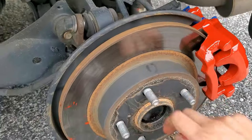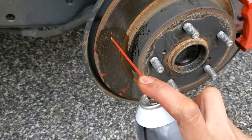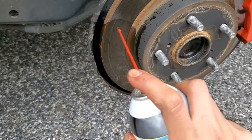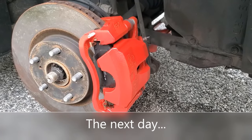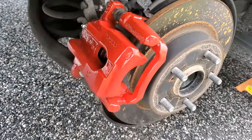Time to do some minor cleanup. Go ahead and rotate the rotors and take whatever brake cleaner you have left and spray it right on. Note that this paint is supposed to be chemical resistant, but only once it's cured — until then, you can use brake cleaner to remove it. I let the paint dry overnight before touching the calipers to reassemble them. Just reverse the process: put the clips back in, put the pads back in, and put the caliper over top, then the bolts.